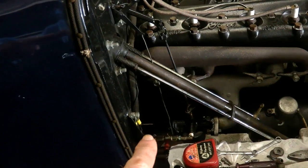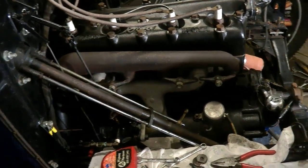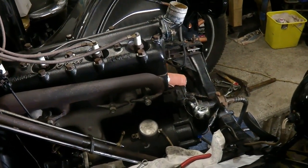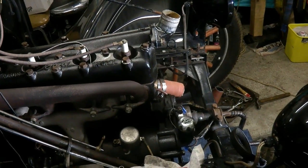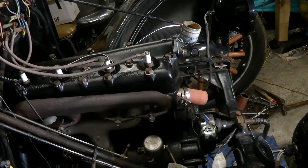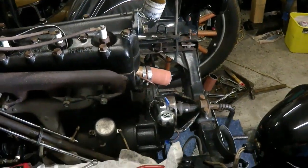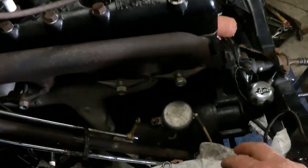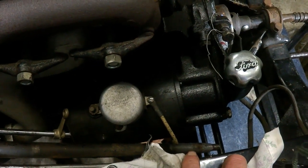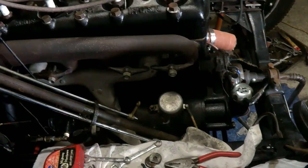So that made it harder to operate, and in addition to that I've had enormous trouble getting the mixture right on this particular carburettor. And one other problem — in driving around locally I've developed a case of the front wheel wobbles, which anyone that's driven a T would know. It's quite an experience, usually at low speeds, when your front wheels start to wobble backwards and forwards and the steering wheel dances around in your hands. I've tightened up the front links — they weren't too bad — but the problem was the bottom steering shaft bracket. The bush was worn — not only worn, terribly worn — and I've just pulled that out to re-bush it.